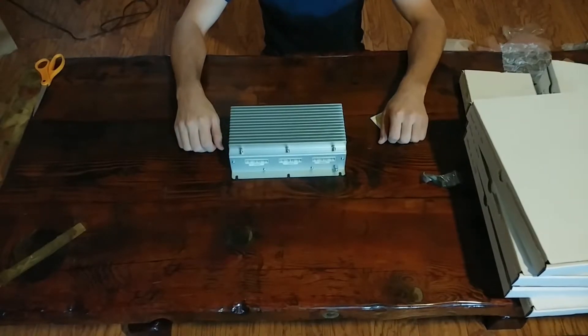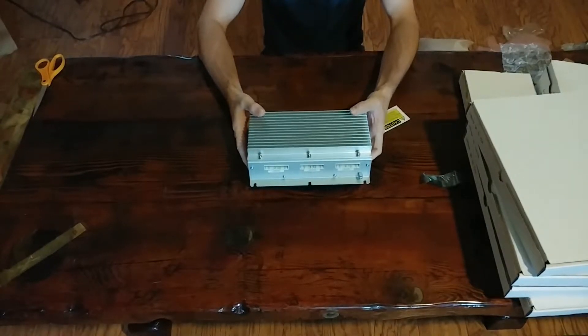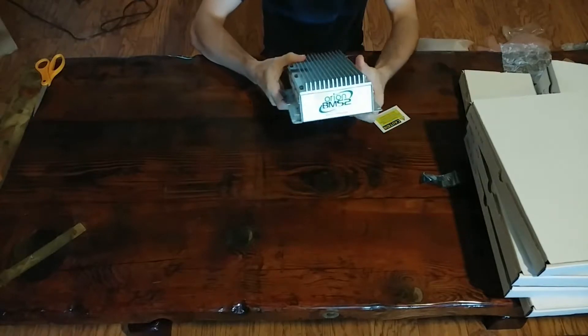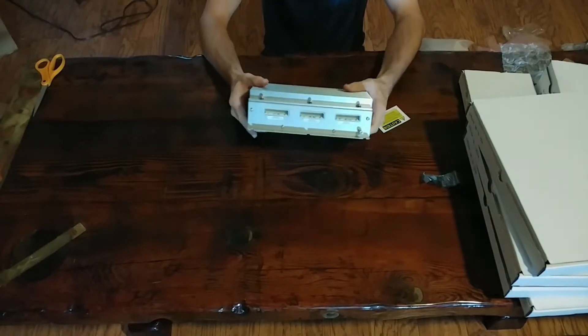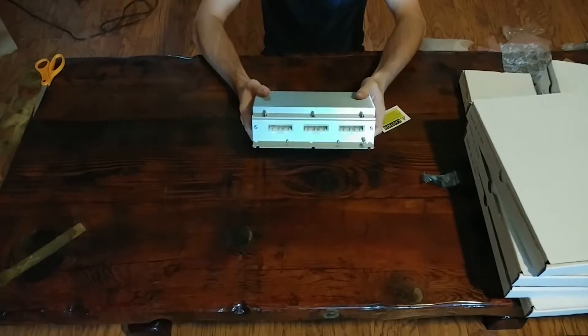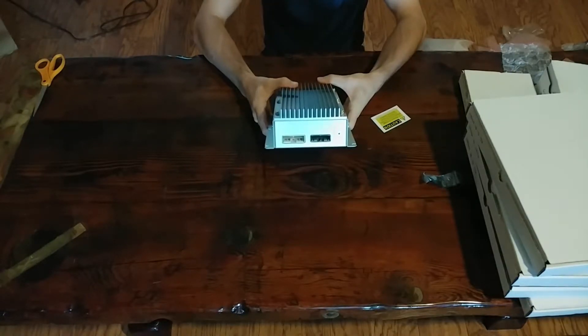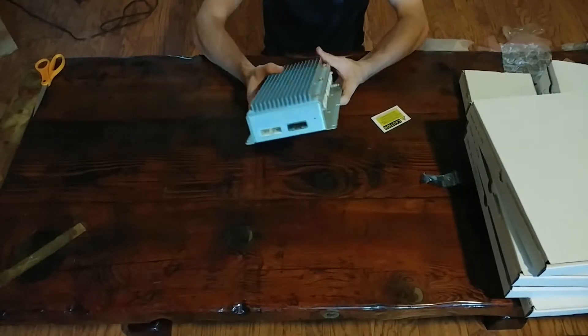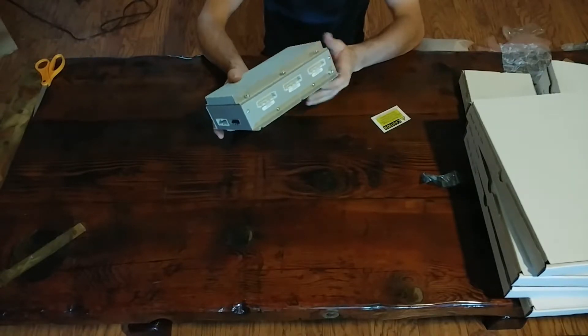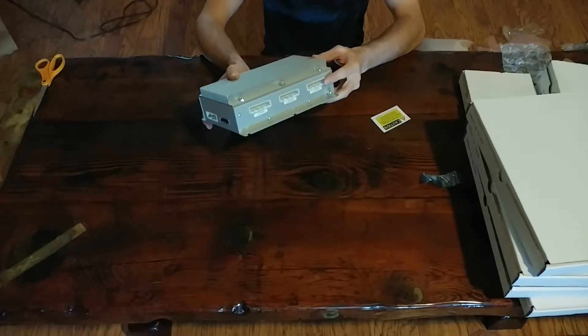What I just got was a box full of battery management and related parts. This right here is the actual battery management system — an Orion BMS2. It has connections for 108 total battery cells, of which I'll use 100, as well as connections for CAN bus communication with charger, instrumentation, current shunt, thermistors, and things of that nature. All the cells have to wire into this main unit, which does measurement of each individual cell voltage.